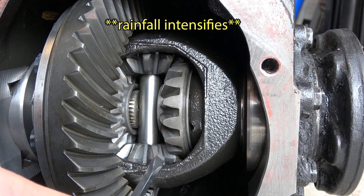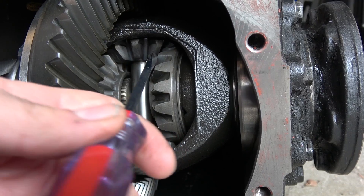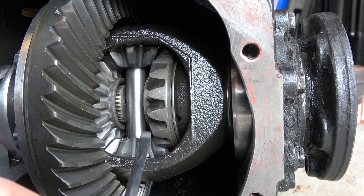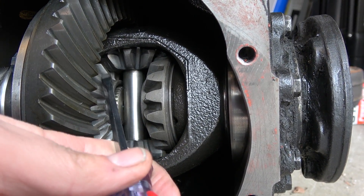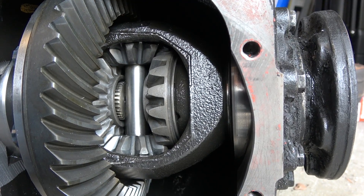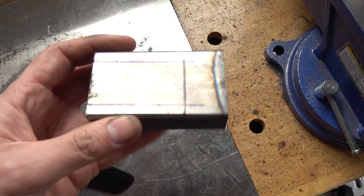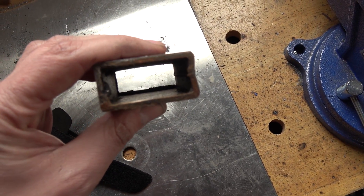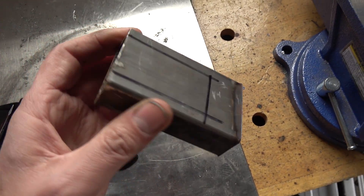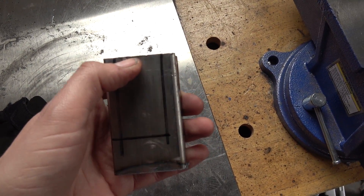It's time to start planning how to weld this thing. Some people just weld the four corners — each corner of the spider gears — and that's usually totally fine. What I'm going to do is the plate method: taking a plate of steel inside here and welding the sides of the steel to all four spider gears. That to me is going to be the strongest way to make sure this thing stands up to lots of abuse. I was looking through my garage and found this leftover eighth-inch steel from my transmission mount — it should be thin enough to bend but thick enough to be strong inside the differential.